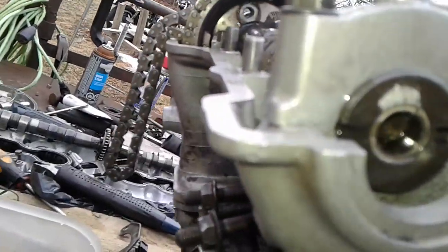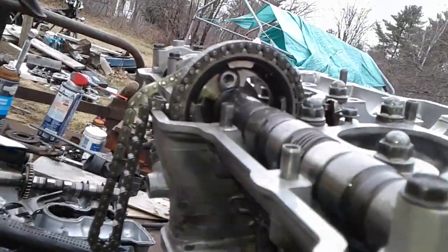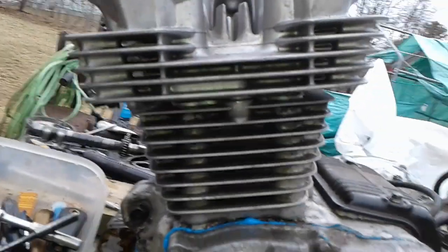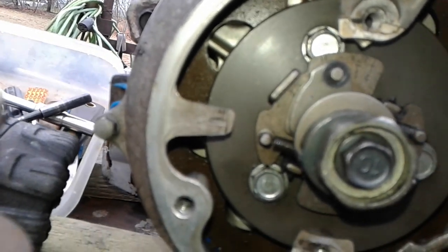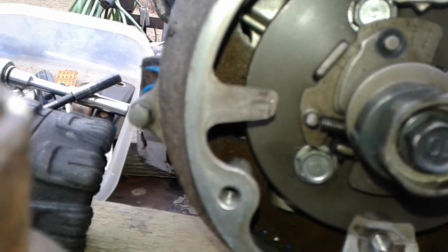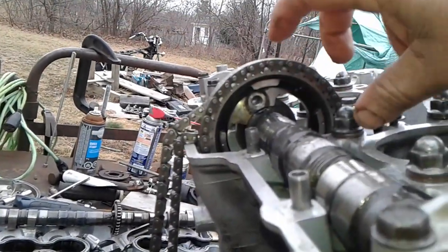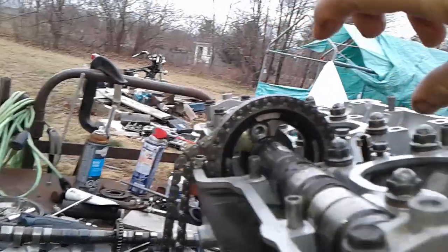See that the camshaft being level with the head — that timing is right, the cam marks are right. I didn't have that tightened yesterday, so it slipped. See the timing mark, there's the pointer — it slipped. It's near the firing point, not the actual timing point, so I'm going to turn it to the timing mark. I've got both nuts out of the sprocket, keeping the sprocket on the holder.